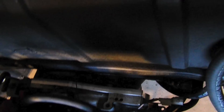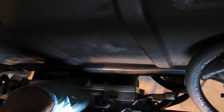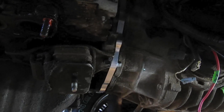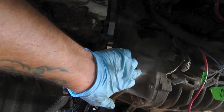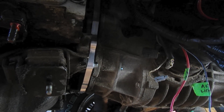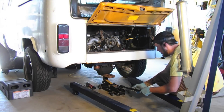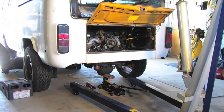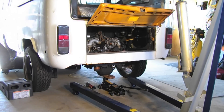If we come in here, we can see that we're just about made it. The lip of the adapter plate is almost right upon the lip of the bell housing. From this angle, we can also see that the adapter plate is just about touching the lip there, and we see a little nub of the stud sticking out — looks like we're just about in. After tightening the nuts on the four studs, you can then slacken the chain for the engine hoist and pull out the jack, and those four bolts will hold the engine in place while you work in the exhaust and the crossmember.